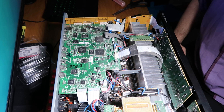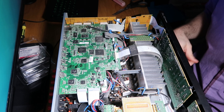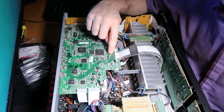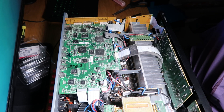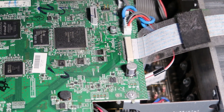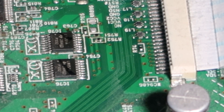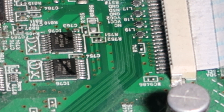I'm now back. I've undone the screws around the edge and taken the case off just so you can see. I'll point it out and then zoom in. Just here on the board there are two little tiny pads labelled R896. Let me zoom in so you can see. Basically, we just need to jumper those and that will let us solve this problem. It's just these two little pads just here.